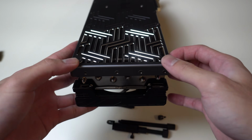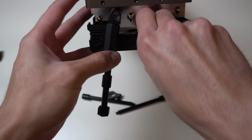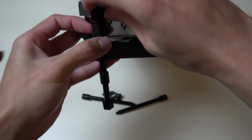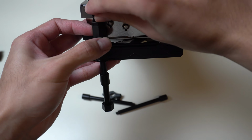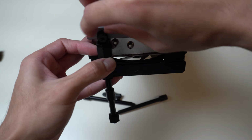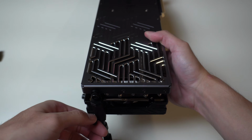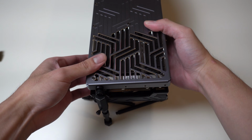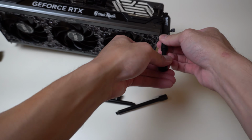And these kind of mounting holes are actually quite common in graphics cards because lots of OEMs use them to bolt graphics cards onto the cases to prevent them from shaking during shipping. And in this case, Palit used them to bolt onto their graphics card rod, which you can just screw onto using the included thumb screw onto the rod, as you can see me trying to do here. Although it is kind of difficult to put this in, but you basically just screw it into any of the holes you want, although the edge one is much more useful. And you can adjust the height on the rod itself to adjust how much the GPU is getting supported by the rod itself, instead of just using the PCIe bracket, for example, which is kind of a lot for a GPU of this weight.